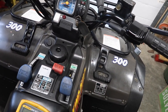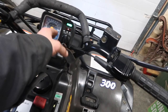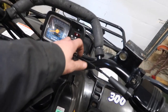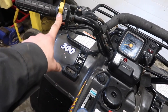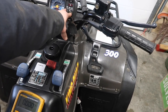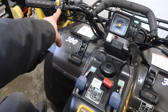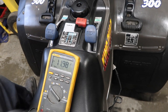Let's start off and hopefully make this simple. You've got a red wire coming from your battery up front that runs to your key switch. You turn it on and you've got power at it. Then there's an orange wire that runs from there up to your kill switch, and from there an orange and white wire runs to your CDI. So when you turn on your ATV and your kill switch is in the run position, power comes from your battery through the key switch, through the kill switch, down to your CDI and provides it 12 volts.